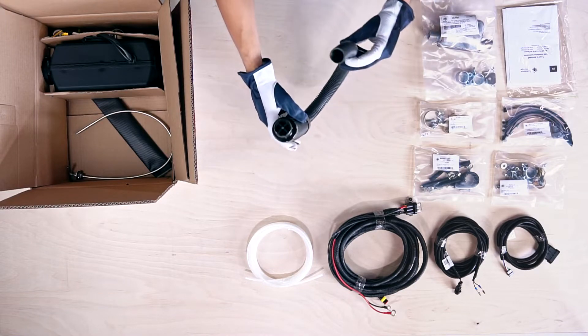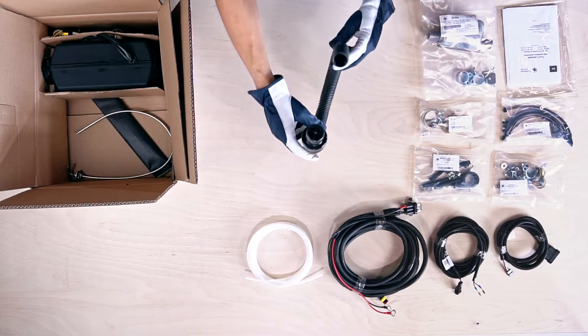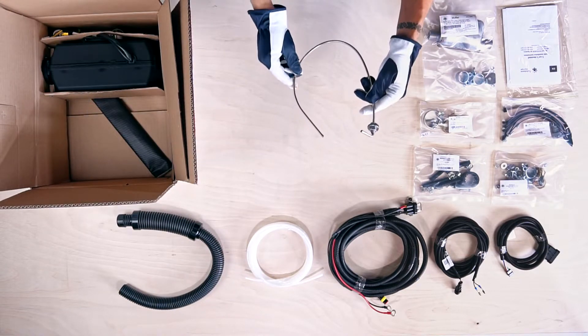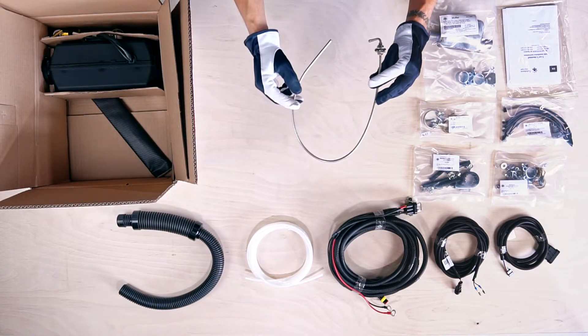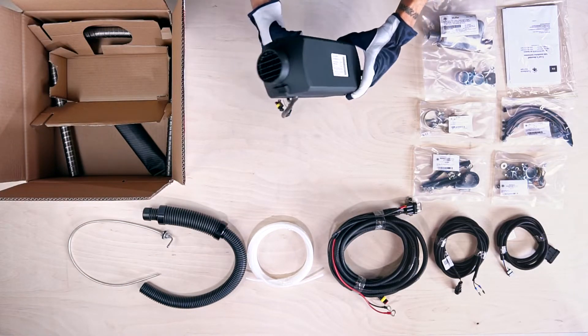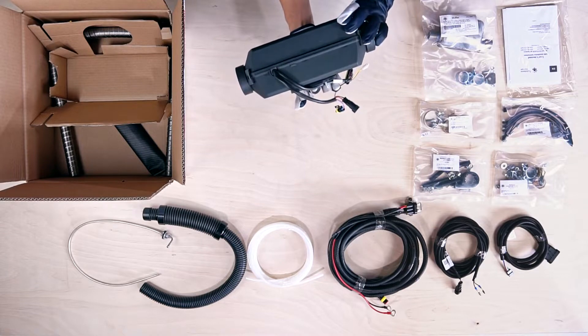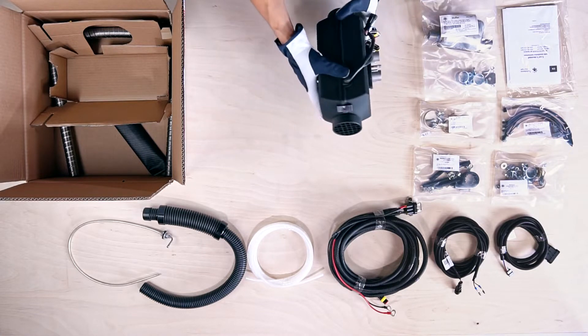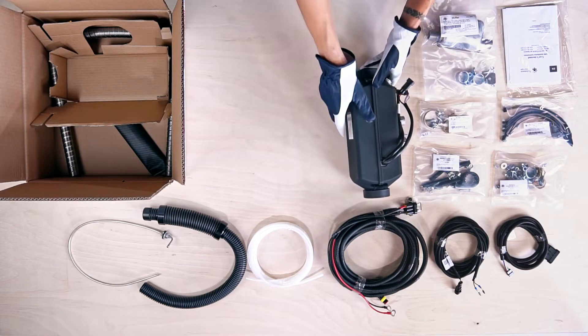This U-shaped pipe is a 65cm air intake pipe with silencer. Next we have the 60cm fuel stand pipe with M8 thread. The Autoterm Air 2D is the most compact diesel powered air heater in the series, producing 2kW of heat with a 60mm air inlet and outlet.